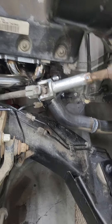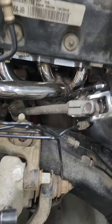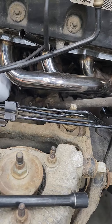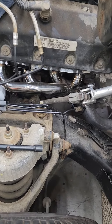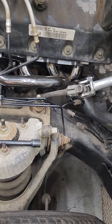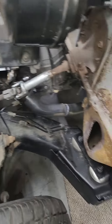I'll either cut and weld the EGR port or just plug it, because with the Holley Terminator kit there's no EGR anyway. This video is really about the fitment. I bought like five different sets of headers — longs and everything else — and these are the only ones that fit and actually cleared everything, especially the steering.